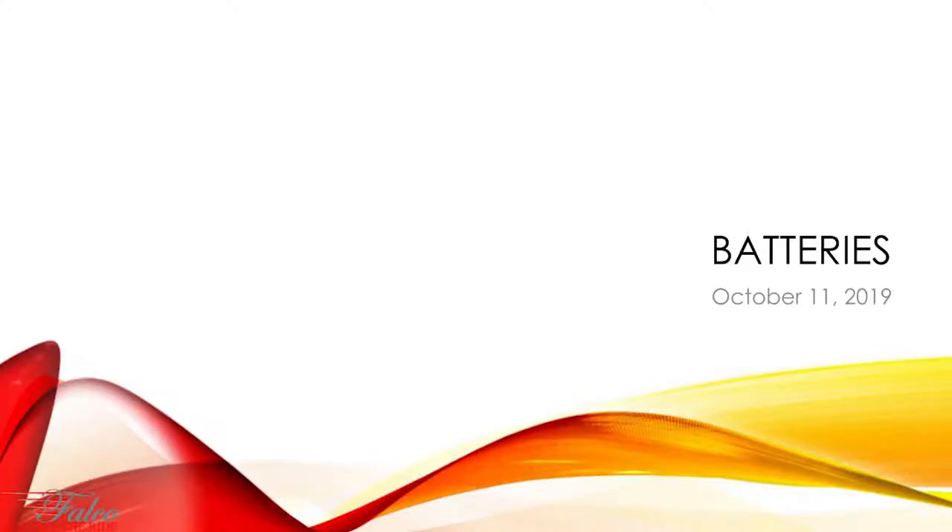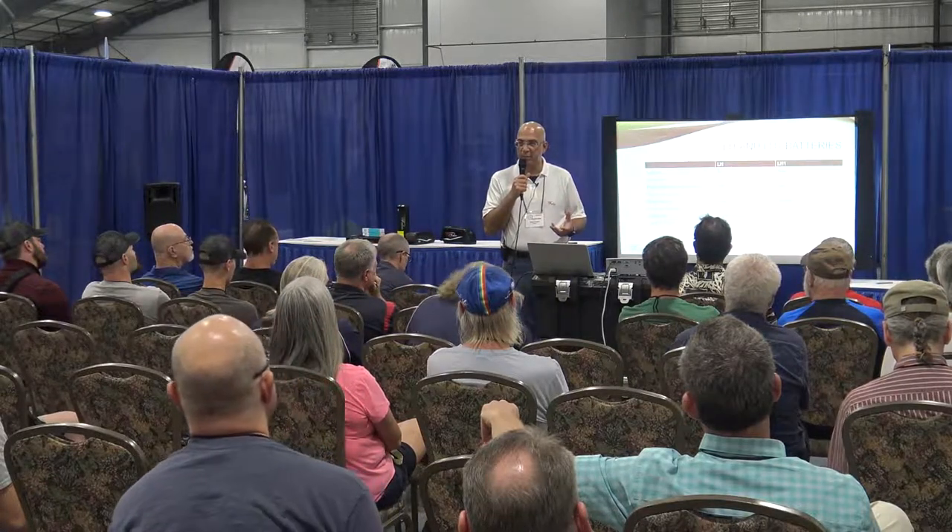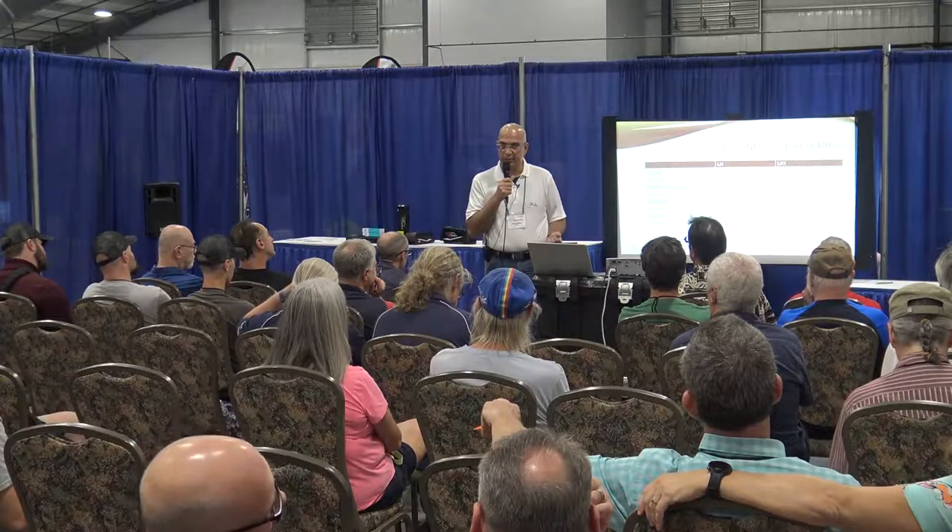We have two flat-pack batteries: LI1 and LI11, at 36V and 48V respectively. Peak power for the 36V battery is about 1000W, and 1400W for LI11. Watt hours: 400 for LI1, 500 for LI11. Storage temperature is between -20 to 35 degrees Celsius. Batteries are very much like humans — they don't like extreme temperatures. In extreme cold the battery will shut down; in extreme heat the battery's protection circuitry can also shut it down.